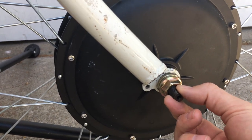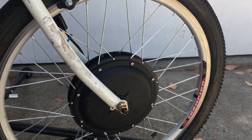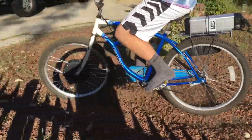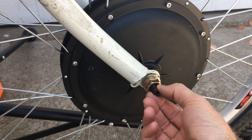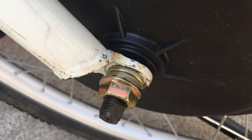This front hub motor will do burnouts and it'll do 30 miles an hour top speed. So to keep it from breaking here, or just jumping out of the hole, you give it a little more stability with the torque arm kit.